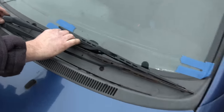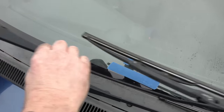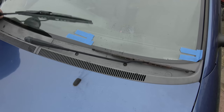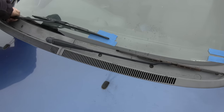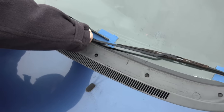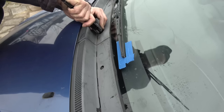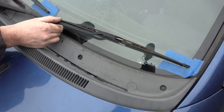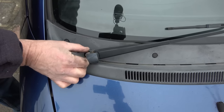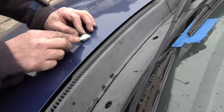When you put your wipers back on you'll probably get them mixed up like we did. One is longer than the other - the longer one goes on the right-hand side because the spindle is offset from the centre of the car, so that side has to be longer. Obviously on a UK car it might be different depending on your country. We're lining that one up with our tape mark and lifting it to drop back on, similar to how it was taken off. Now we're just going to clean up that jet a little bit with an old toothbrush.